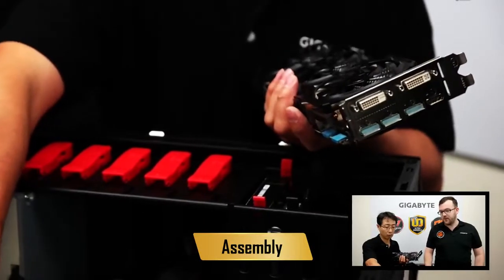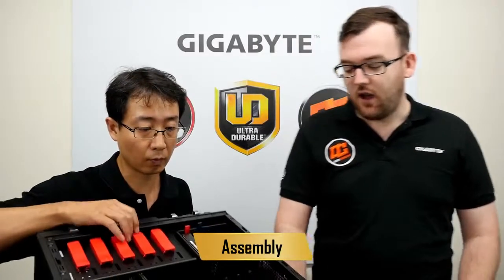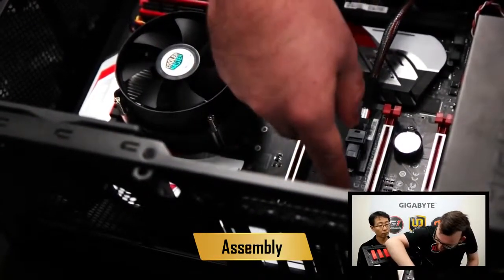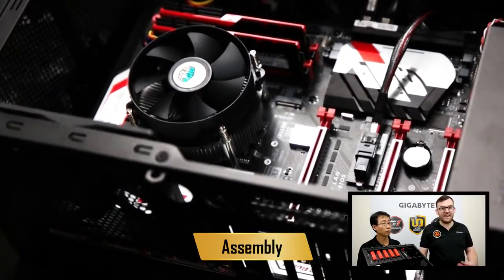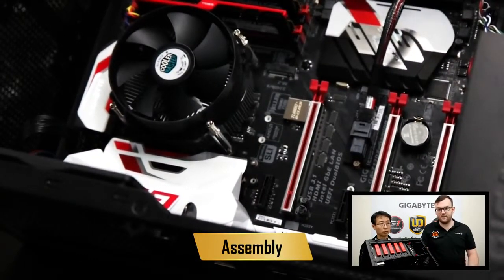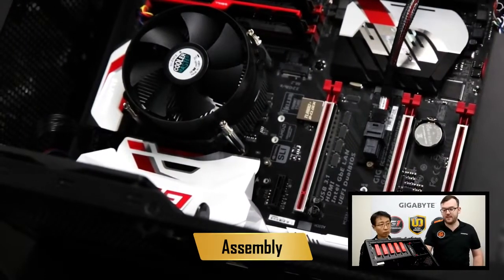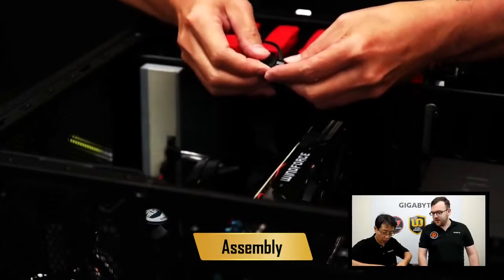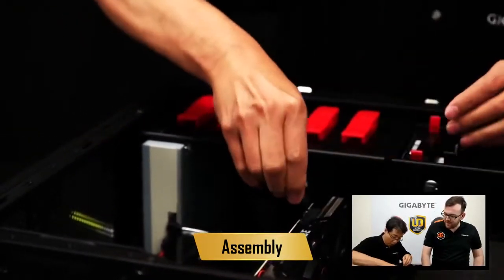It's time to install the VGA card. You can't just install the VGA card in any PCIe slot. If you look closely at the board, each PCIe slot has a number by it — in this case we have X16, X8, and X4 — which shows what PCIe lanes are available. You want to make sure your graphics card is in the highest slot possible to have the most lanes and the most bandwidth to your card. We're going to use this X16 PCIe slot. VGA cards also need power themselves, so we have a power connector that we need to connect the power cables to.